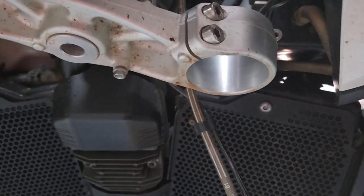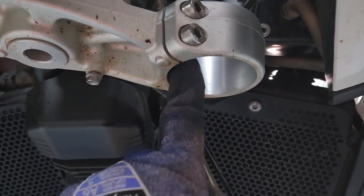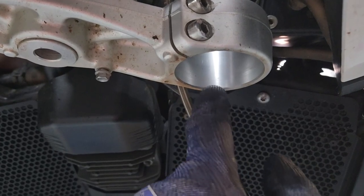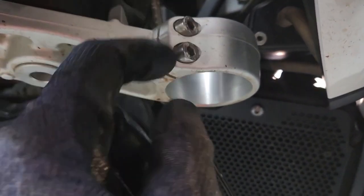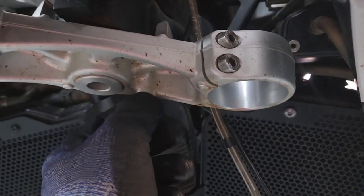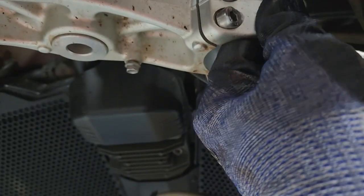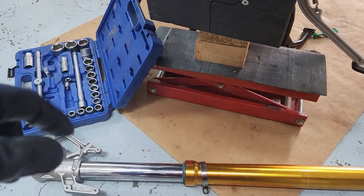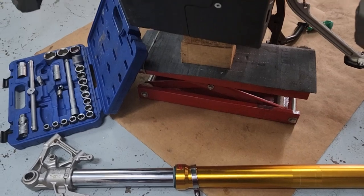Done. Important tips when installing: take a nice clean cloth, bit of brake cleaner, wipe out everything — it needs to be perfectly clean, it needs optimum grip. If you want to take these out clean them to get all the muck out. Use Loctite on these if possible. Be gentle — you've worked hard. And don't forget the clip that holds the brake line.